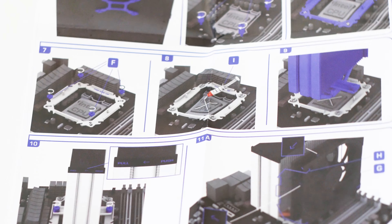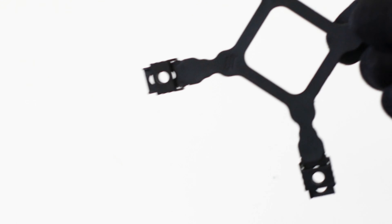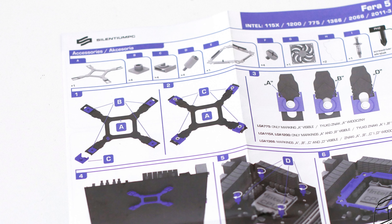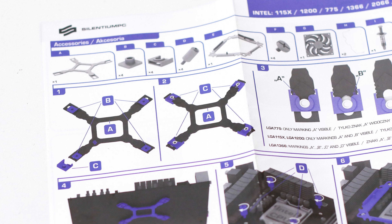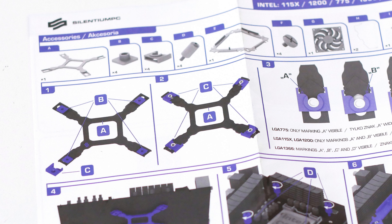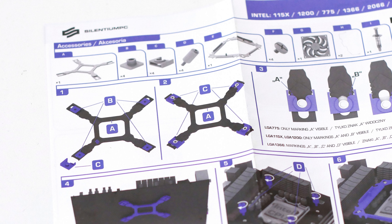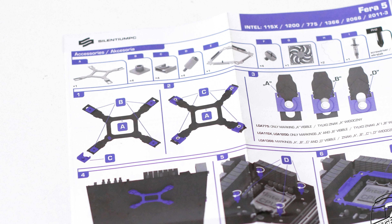The installation of this CPU cooler is very easy. You first get the backplate and install the plastic clips in the correct spaces for your socket. However, there is one error in the manual worth noting. While the user manual is great overall, it has one flaw that needs to be addressed. On the very first page, two small photos also tell you to install metal threaded inserts into the backplate before securing them with the plastic clips — and if you look at the manual for the first time, you will miss this crucial step. Please take notice of this when you install the cooler.